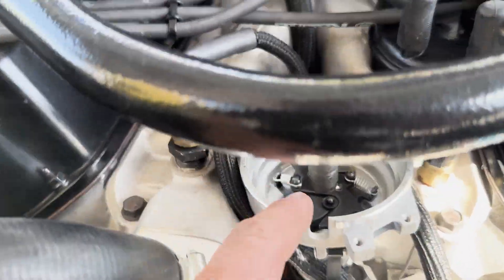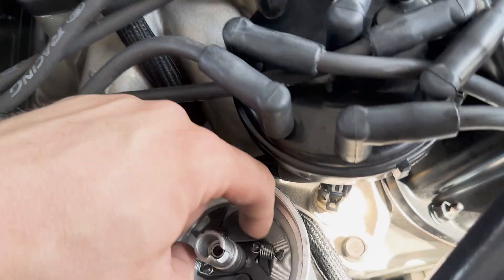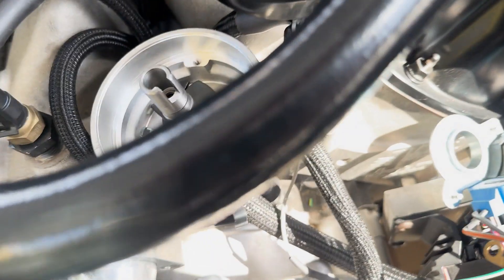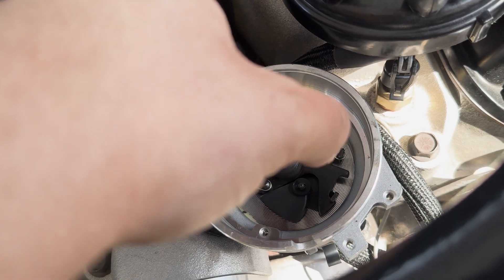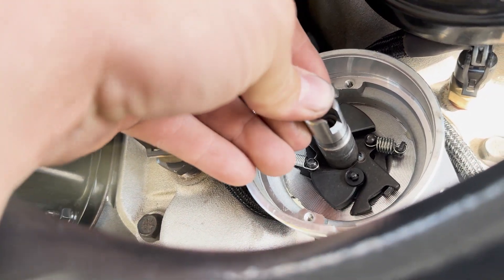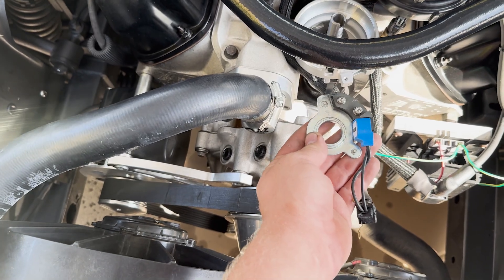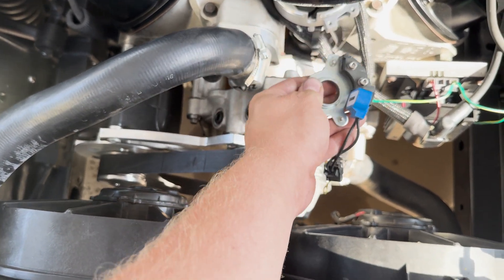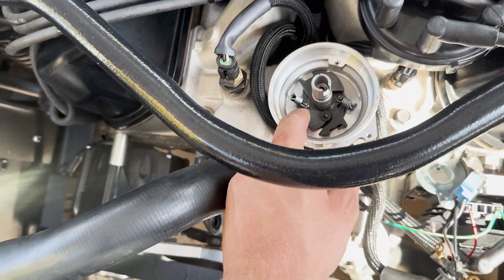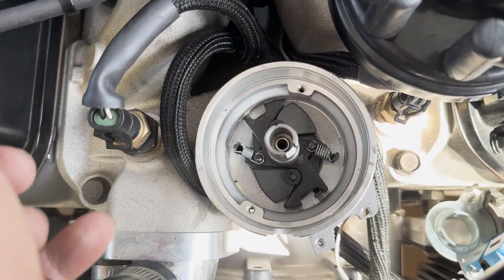I got this blasted apart. The way it typically works — which I didn't realize — is these weights rotate out and advance the reluctor relative to the inner shaft of the distributor, causing the variable reluctor to put a signal on the HEI or DuraSpark module sooner, which causes the spark to happen sooner, advancing timing. Similarly, the vacuum advance pulls on the plate and rotates it, advancing the distributor because the magnetic pickup is more advanced, triggering the spark earlier. We're going to put a couple of tack welds between these weights and the piece the reluctor mounts on, keeping everything solid so timing won't move on us.